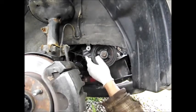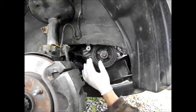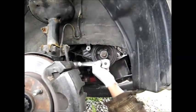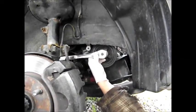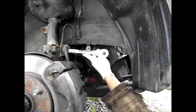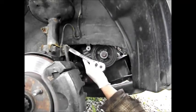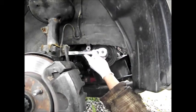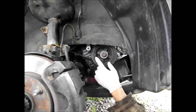So whether my belts are on or off, it doesn't matter. Just get this between the axle and the frame. Watch you don't get your brake line up in there. You saw how I turned the motor over by hand to get this up in there tight. A lot of times when you bump the starter it'll crack the bolt loose and the ratchet will fall off — that time it stayed on.